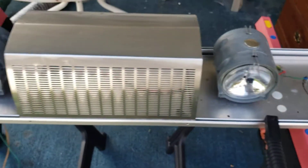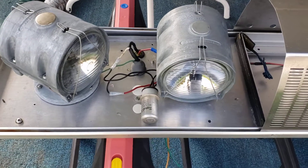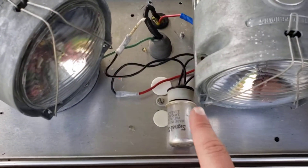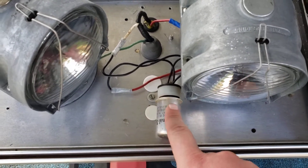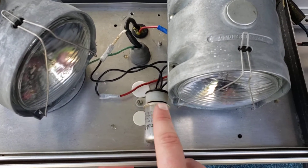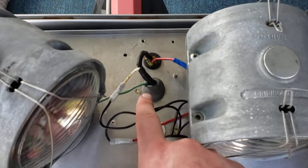I've been playing around with some wiring gremlins — talked to some other people about this already. One of the gremlins had to do with the way this flasher is wired up. I know this isn't right; there's supposed to be a power cable coming in here, but I'm using it as a holder for a flasher. So I figured I'd replace the flasher — flasher is now working.